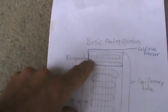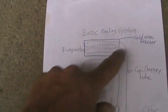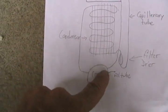The liquid Freon then flows up that tiny capillary tube all the way to the top, into the evaporator — that's the cooling coil in the freezer. It has fewer coils than on the back. It percolates its way down and comes all the way back to get recirculated into the input of the compressor.